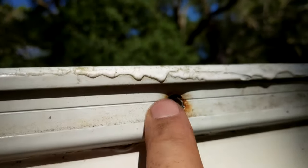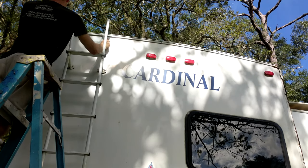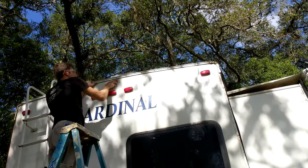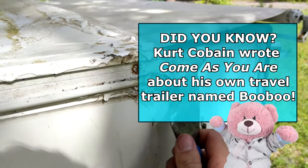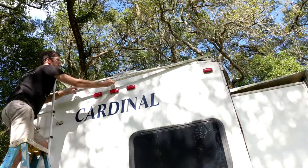With our special screwbygone methods used, now we can cut the caulk. Using our utility knife, we slice open the caulk on the side of the roof trim. Take your time. Pull out your prying tools — your putty knife and your paint tool — to start prying that bad boy off. When looser underneath, we can lightly score the top to get the whole thing off.